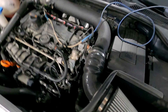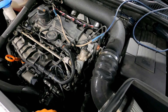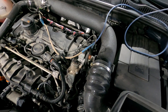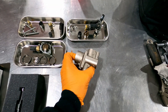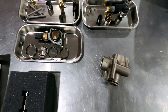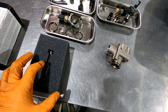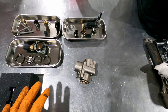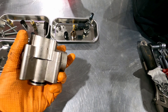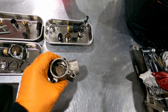We'll take full advantage of the bolt-ons once the software is on. After a cool-down with the fans, we're pulling out the high-pressure fuel pump. I'll relieve the pressure and pull it out, then get it apart on the bench. The pump is completely disassembled — all the pieces inside shown here — alongside the new replacement Autotech pump. I've done these so many times I can do it with my eyes closed. I always fully disassemble and clean the pump thoroughly; this one is actually really clean.